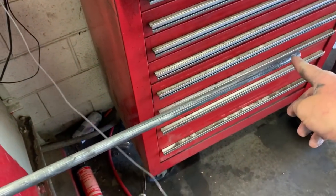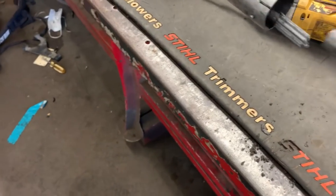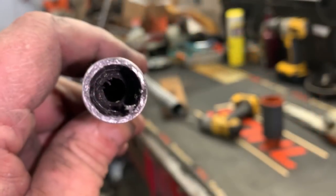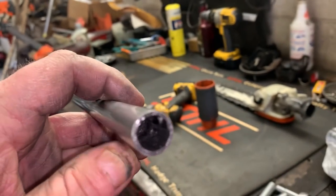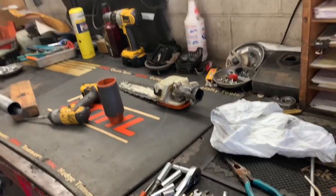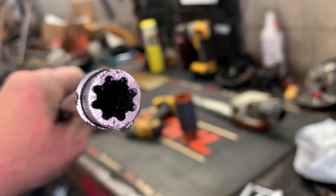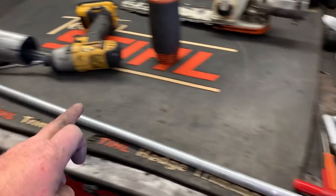Here's the end of our spline that's eaten out, as we can tell. The reason it won't come out is because it's got a snap ring around the shaft there. So we know that the shaft is eaten out right here, and we also know that this spline extends all the way down the shaft to the other end. Just this aluminum shaft is over one hundred dollars.